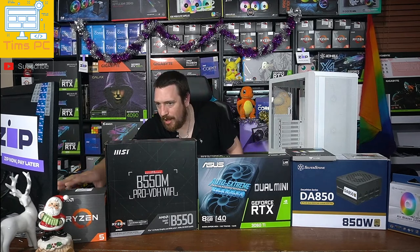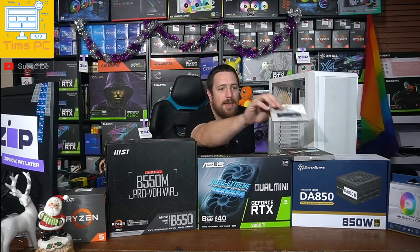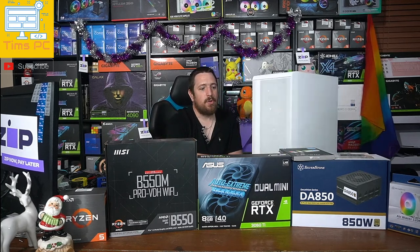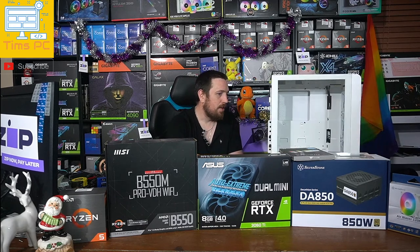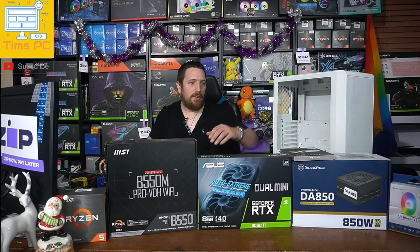Alrighty, so this build here, we've got a Ryzen 5600, an MSI B550M Pro VDH Wi-Fi, a little Asus RTX 3060 Ti, a 32GB kit of white Thermaltake Toughram, a 1TB NVMe SSD, and a big 850W power supply, so we're going to be completely fine to upgrade our 3060 Ti when the time's right. And the aforementioned S200 in white. A very, very nice looking little case. Okay, so let's get started.